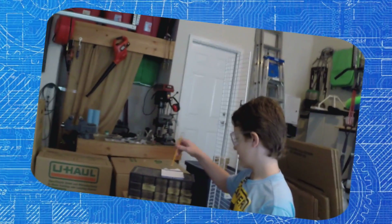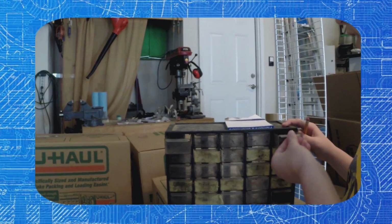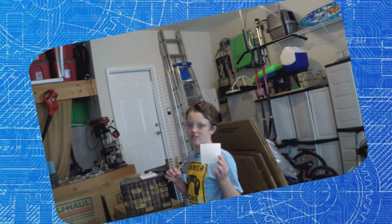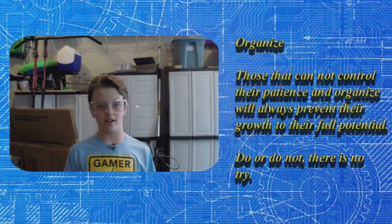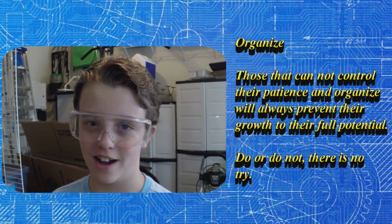Organize! Have a small parts bin handy. As you take off fasteners, fill the trays from left to right and top to bottom. Stuff a note in each tray describing what the fasteners are for. You can also write down tips to help with the installation later. And don't get cocky and skip this. Only tiny baby jobs won't require this.